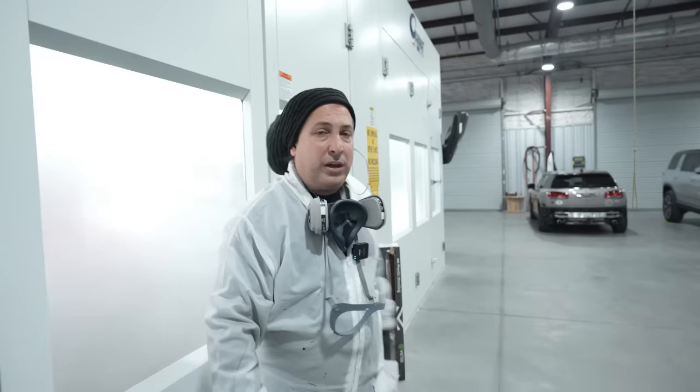So you guys see that we hit it with that etch, right? That is what they want you to do when you get a little bit more area than just bare metal edges. So we did it as a precaution to make sure we're going to have it done right. Make sure you let it flash for 5 minutes before you go ahead and tack it and then seal it. That way it's flashed off. And then we went ahead and hit it with our normal sealer.